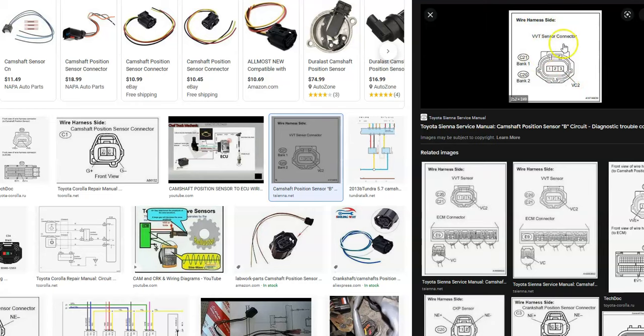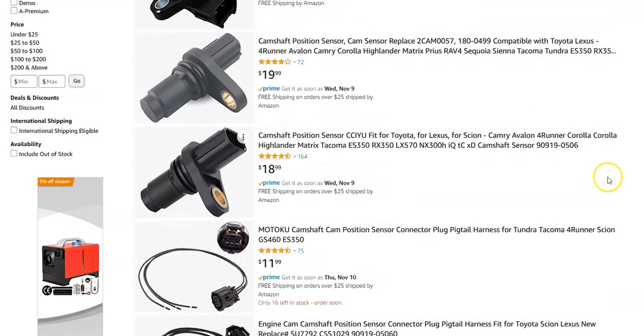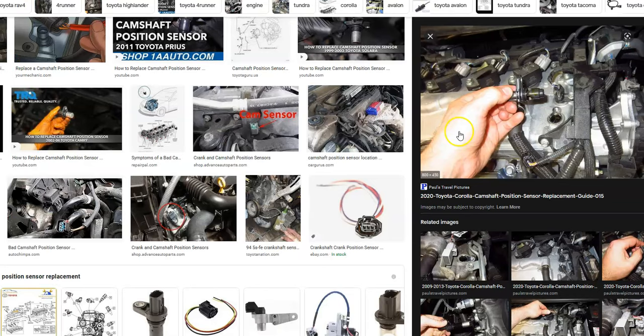And so if you check out all the wiring and all that looks good, and you're not having any issues there, then very likely it's going to be a bad camshaft position sensor. And they're just low-cost items. They're ranging like $20, $30. Jump on Amazon, give you an idea. So they're not high-cost parts or anything. And replacing them on a Toyota is usually pretty easy.